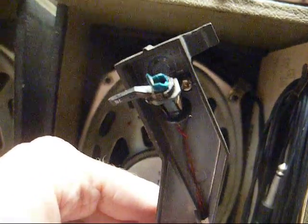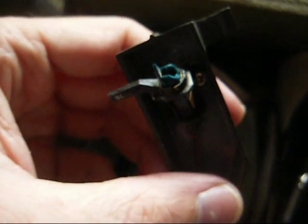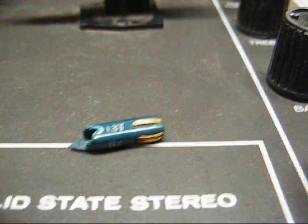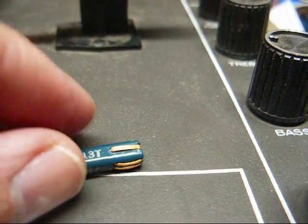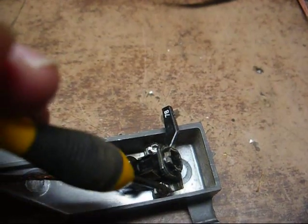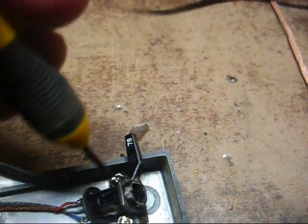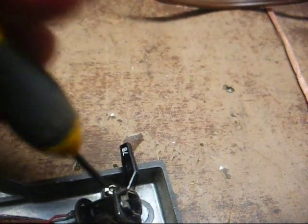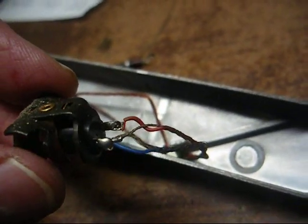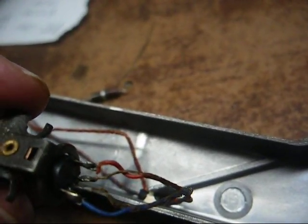I'll give you a good look at the holder here that the original cartridge mounts in. Here's what's left of the old 13T cartridge — as you can see, it's pretty well torn up. Physically it looks just like an 89T, but we have four connectors: two on the bottom and one on each side of the cartridge. This is held in with two screws. I like to take one screw completely out and just loosen the other screw enough to slip the holder out. Red is right plus, blue is left plus, and then we have our two shield wires that will need to be unsoldered.